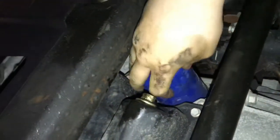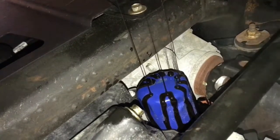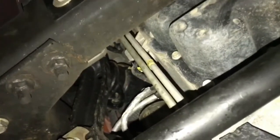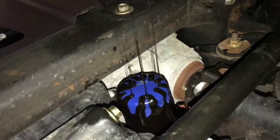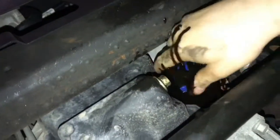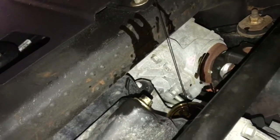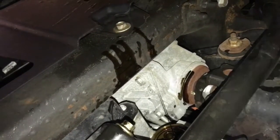With the help of an oil filter wrench — if I would have really cranked hard it probably would have came off without the wrench, but man that's nice. I'm gonna take my new filter and grab just a little oil on top of it to keep that seal good. Obviously always wear gloves when you do this. Since this hand is drenched in oil I'm gonna use my other hand to get that filter screwed back up on there.